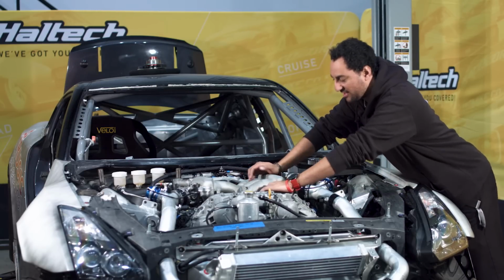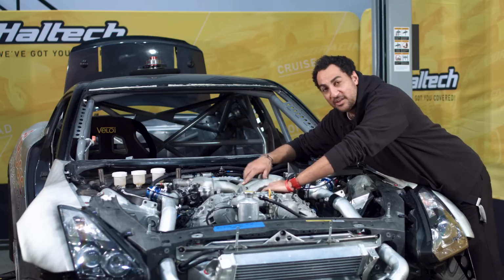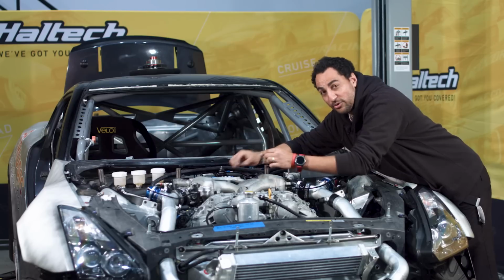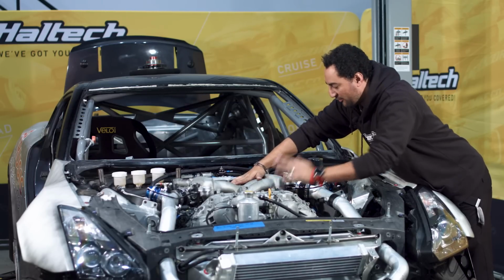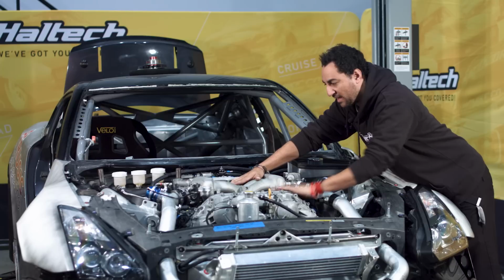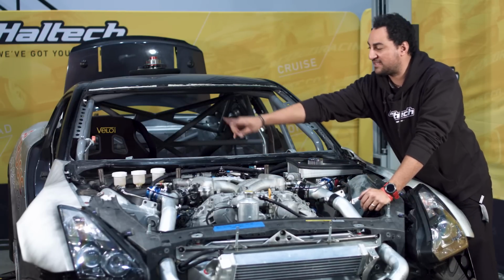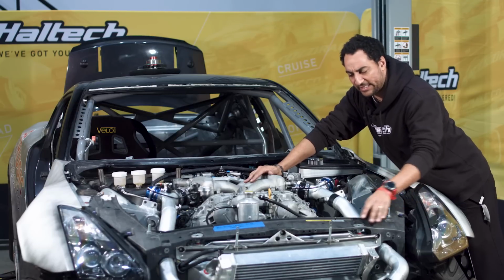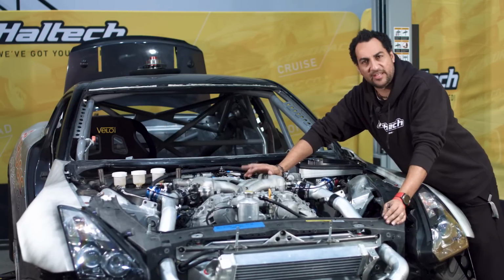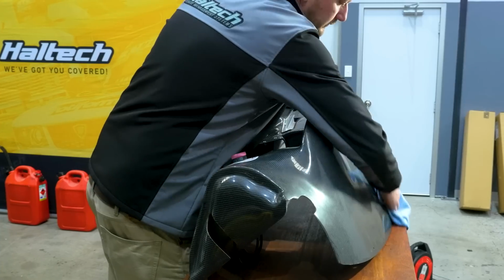The injectors, I didn't show you plugging them in just because they were really annoying. So I took the rails out, plugged in all of those injectors, put the rails back in, put the manifold back on. We've got our throttles connected up, coils connected up. That's really about it. Our map sensor is on an extension over there. We will go through and P-clip all of these properly. The zip ties are just holding everything in place for now, just so we can confirm everything is working.